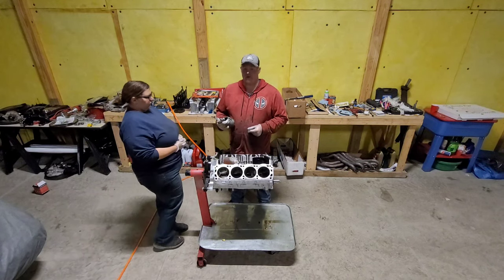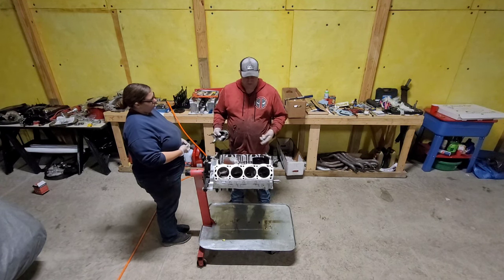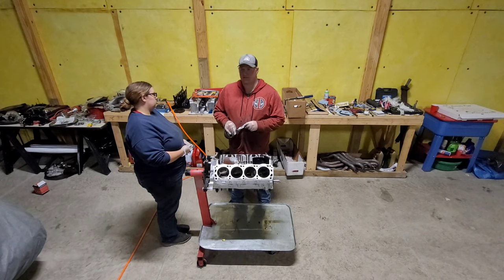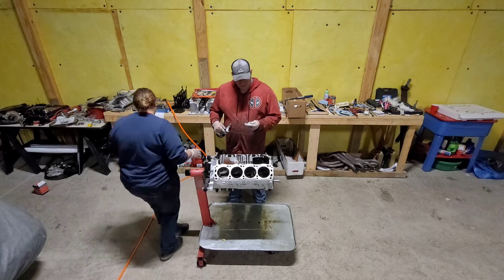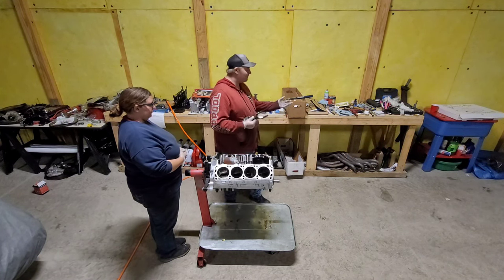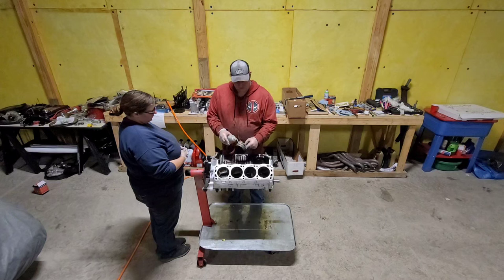He's our fancy piston. Now, you really don't want to shove this feller down in there with these out, because that beautiful crankshaft you just spent money on to have balanced and everything, I mean, we're on a budget here, putting a nick in that? Nope. So, you can buy the little fancy protectors. I had them once. They worked great. They're with all the other papers that I said not to lose. Well, what you can do is just buy yourself a little bit of hose here. I have taken a 1 foot piece of hose and turned it into like 15 of those pieces. So we're gonna go ahead and oil on this oil ring.